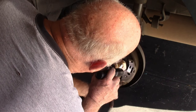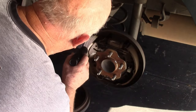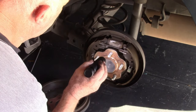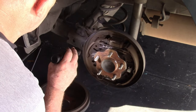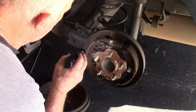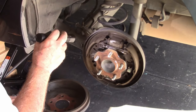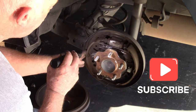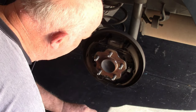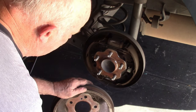Looking through here, you can see there's the thin metal for the backing and then the meat part — that looks like it's about a little less than a quarter inch. When ordering parts, make sure you put in the right model, especially online: they'll ask year, model, whether it's an SE or SES, coupe or whatever. If there's a question, get your VIN number off the vehicle and order based off the VIN number — that way you get the right parts. It can go to like his next oil change; just had one done yesterday, so about the time he's ready for his next oil change it'll be about time to replace these. I don't see any kind of a lip on the inside of the drum, so I'm just going to give it a real light sanding and put this back together.